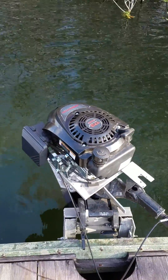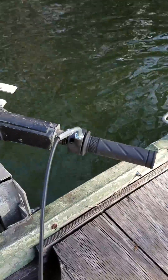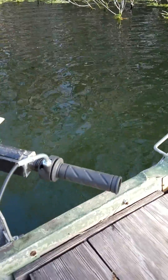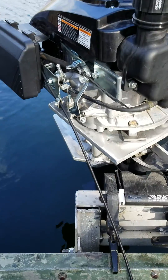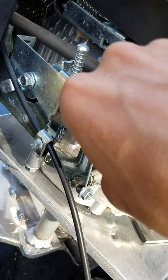I've done a lot of things to it since the last video I posted, but I'll go ahead and begin with the throttle setup that I did. I ended up just getting the twist throttle off of a dirt bike or four-wheeler. I went and bought it new at the moped store, ran the throttle cable back, and I totally removed the governor setup.